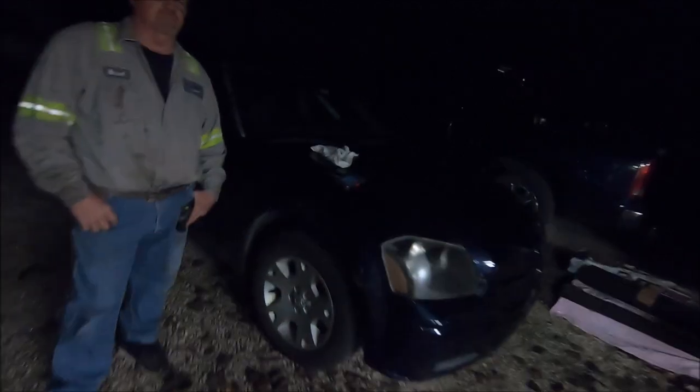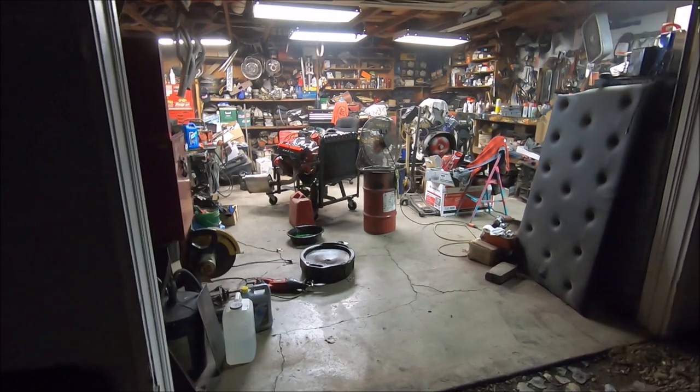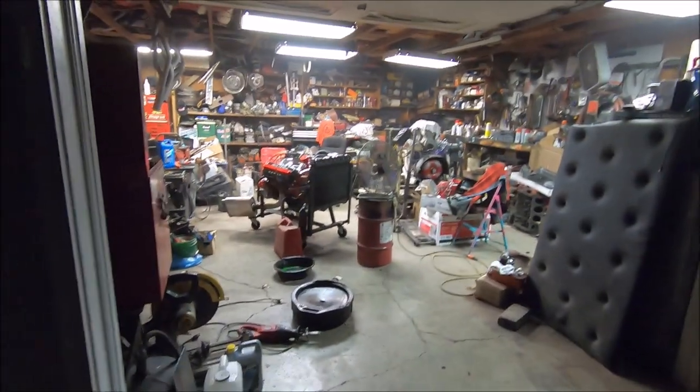Just for you guys, it sounds good out back by the muffler. So cam break-in going pretty smooth. Of course, now that I said that, we're going to get a rod out of the block. It almost sounds like it doesn't idle down very good. It's got a vacuum leak. Might have a vacuum leak. Yeah, I think we definitely got a vacuum leak. I don't know if that carburetor spacer might be leaking. Yeah, it may not be any good. But there she is.